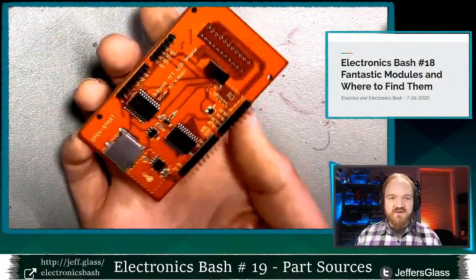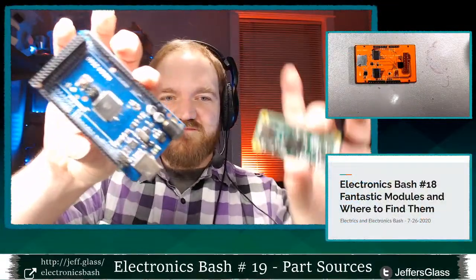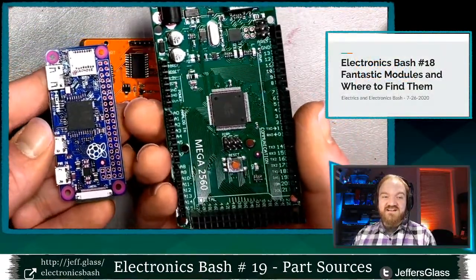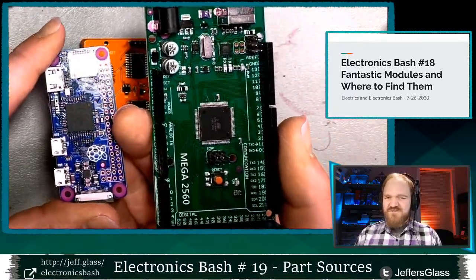On this camera, it looks close. It's orangey. It's pretty good. But things in the green or blue part of the spectrum, so I have a blue circuit board and a blue large and a green small of things. If I look at them under the camera, they become a green large and a blue small. The hues are sort of mirrored across the red axis, if you will.